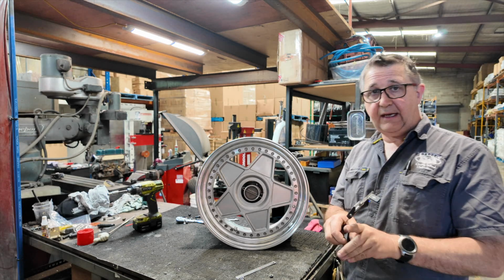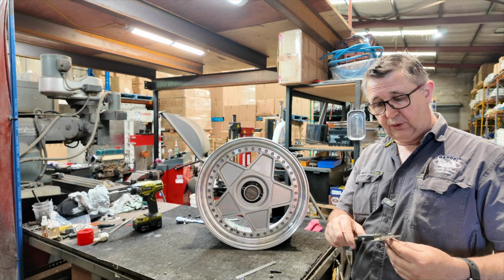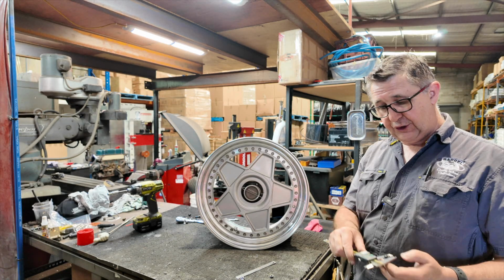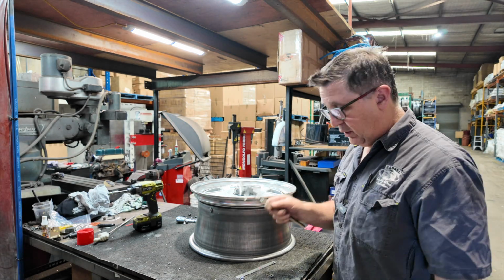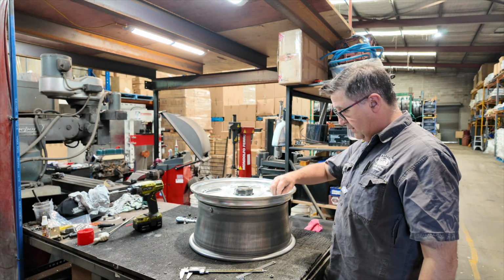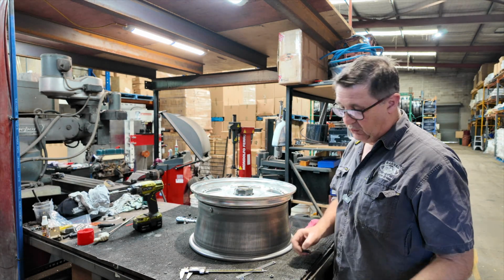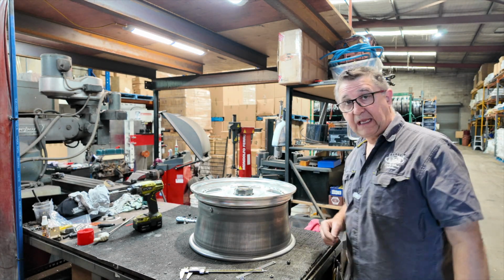Even the standard M7, 12 millimeters, just over 12 millimeters, about 12.1 mil. This one is the smallest head I can find, and it's 13. Let's measure the hole, or the relief, 12.79. So this one doesn't actually fit in there either. I suppose you could pull it down in there, but why stress it? Why not just use the standard bolts, if you can?